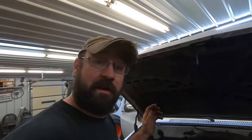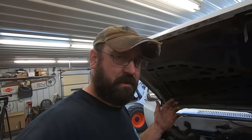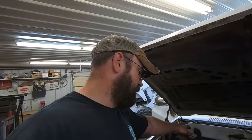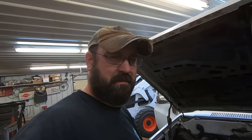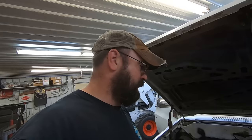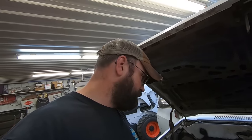It does, in fact, need a fuel pump. I don't know how it worked before. Maybe it would just work for a little while, but yeah, that fuel pump, she's wasted. So I guess we could put that electric pump in line down there and then just bypass that fuel pump so it's not leaking. I'm surprised it wasn't leaking when we were running it that way. It doesn't make any sense to me. Maybe there's just enough fuel in the system, but yep, we need a fuel pump.